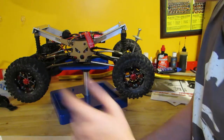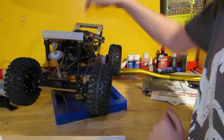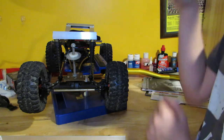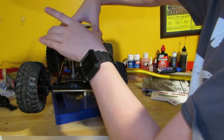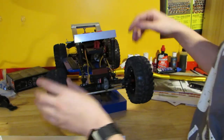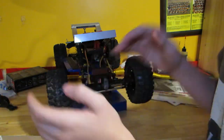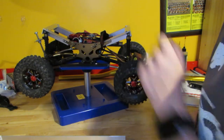Unless you lift it — and then yeah. But as you can see, it has these back and front parts. That is because when these were just here, basically all you did is make a lever, so you are putting way more stress on these parts right here. This is going to keep these from moving in and out, because they are just attached straight to the frame. And when you do that, you are going to allow it to bend easier with the extra torque that is allotted.